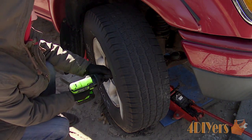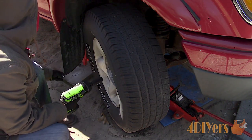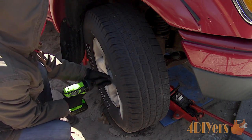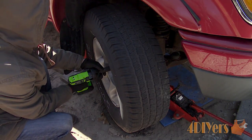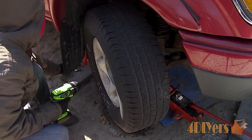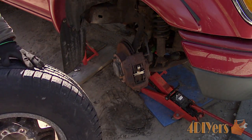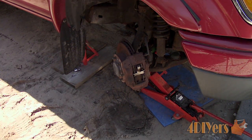You'll most likely want to angle the front of the wheel outward when you're working on it, so it's easier to gain access to the caliper bolts if you're also replacing the rotors. This should be done while the truck is on the ground if you plan to work on one side at a time. Elevate the one wheel and place jack stands under the truck as a safety. Remove the wheel — the lug nuts are 21mm.